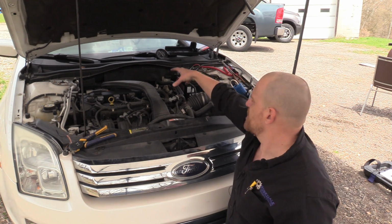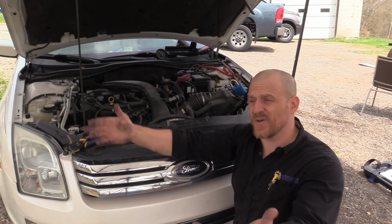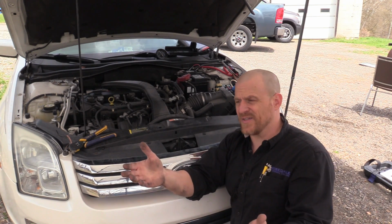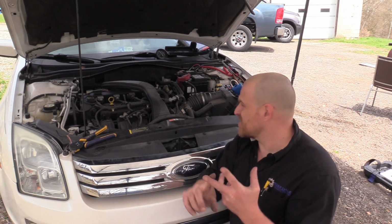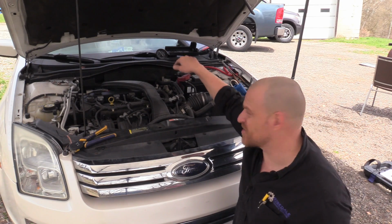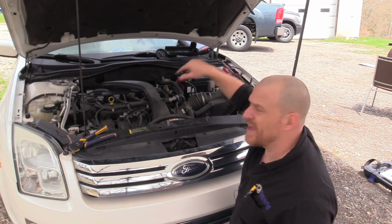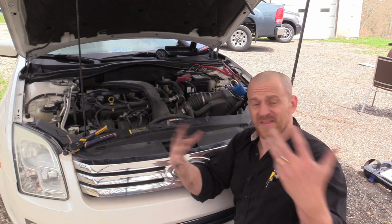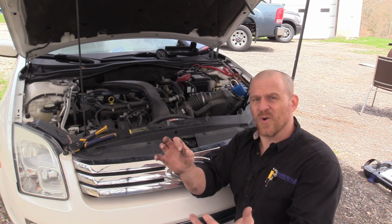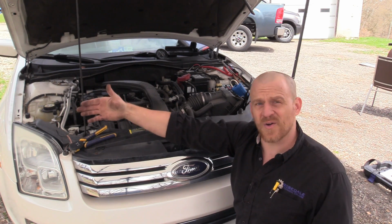And then it comes up to the diverter, and the diverter is vacuum controlled. So we have a solenoid. We did our checks on the diagram. We found out it was power fed and ground side switched. We're going to review that here in a minute because I'm going to show you how to energize that solenoid, the same way I showed you how to energize the relay. So the solenoid's a factor, and let's say that the solenoid worked and you could make it work. You could make airflow go to the diverter, and the diverter worked and you had air going to the exhaust.